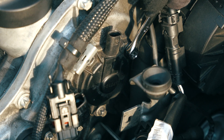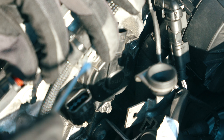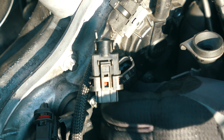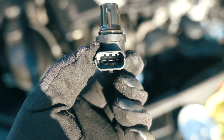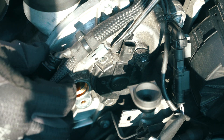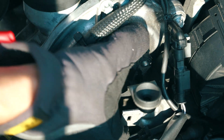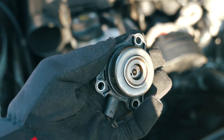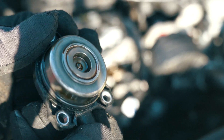First screw out — I can take this out with just a wrench. Got one bolt out. We're going to access the camshaft position sensors first, then we can access the bottom portion. This is the first camshaft position sensor; looks okay, there's no seepage on the bottom. This is the first cam magnet we took out. You can see that gasket part over there has a little bit of gunky oil, which shows you that's the leaky part.